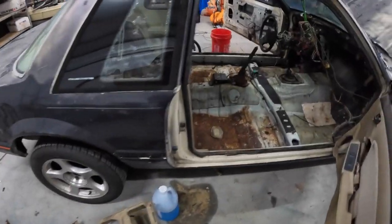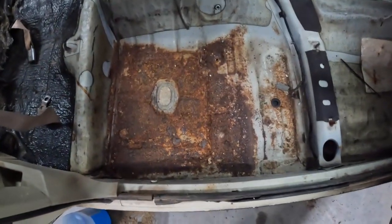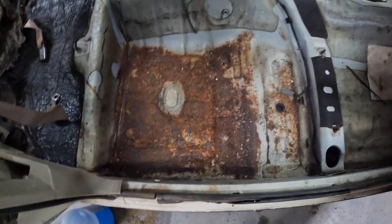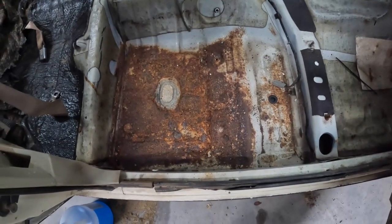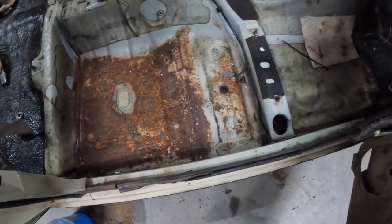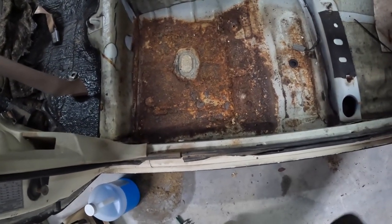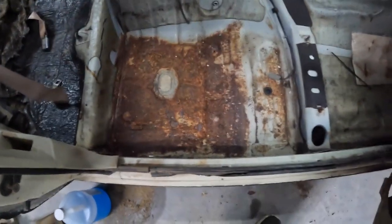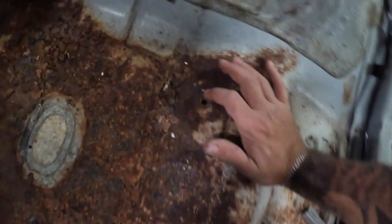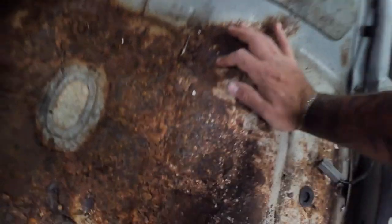See ya. Well, I know this video is about getting the heater core done, but we're gonna do some other stuff too. So I got the carpet out, and if you look, there is a ton of rust in here. From just looking at it, it looks like it's all just surface rust, but I can't be 100% sure of that until I actually go to get it out of here. Actually, that's not really that bad considering, what happens is these bolt holes for the seat aren't water sealed or watertight, so they leak.